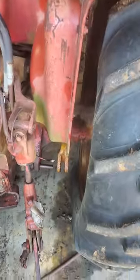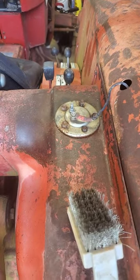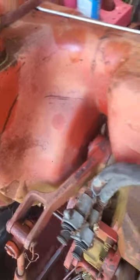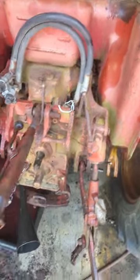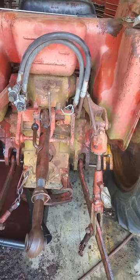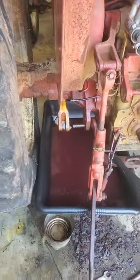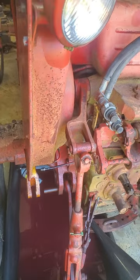I didn't want to fool with it, but I took the sending unit out on this side, cap off on this side, which is easy enough. I took this long screwdriver and scraped around. My dad was right — it was not really rusty. It was more like where it had sat and had a lot of really gummed up old fuel in it, because it did break up pretty clean and came out.